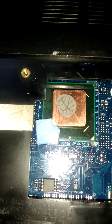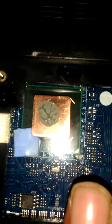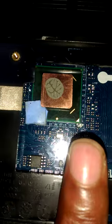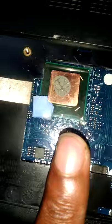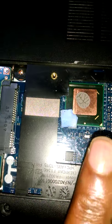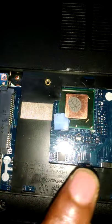Overheating can cause some of the soldering joints to detach from the board. To prevent that, I'm doing a modification just to get the temperature down for the GPU. I've purchased some copper shims from eBay or Amazon, and above the GPU I've added some thermal compound. After adding that, I actually placed two copper shims above the GPU.